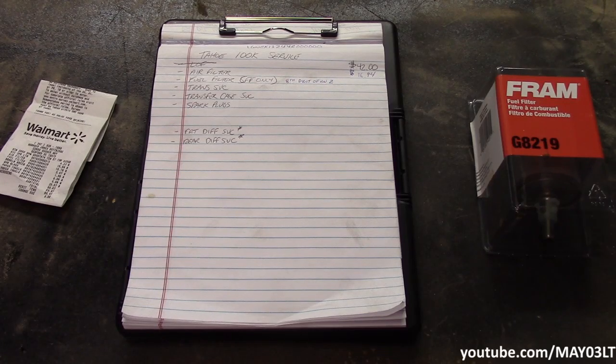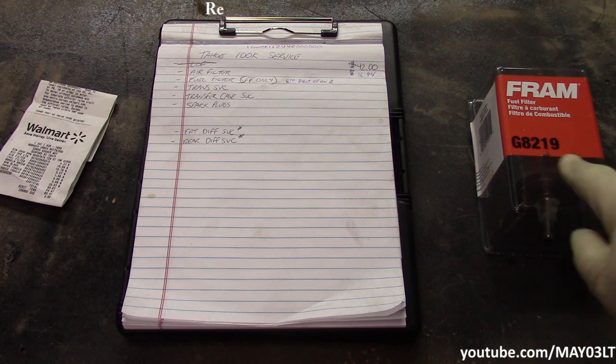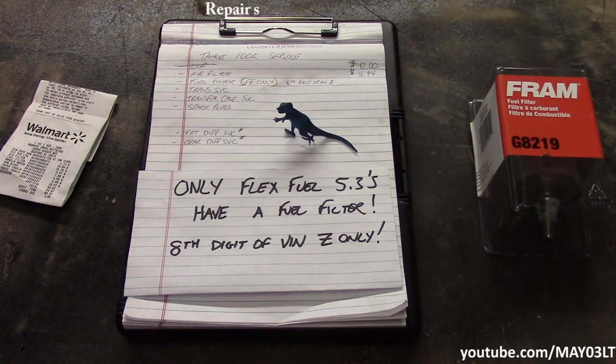All right, we're back with the 2004 Chevy Tahoe 100,000 mile service. This video is for the fuel filter. First, an important note from Mr. T-Rex right here. Only Flex Fuel 5.3s have a fuel filter. The eighth digit of the VIN number, Z only.